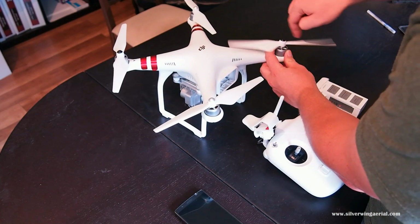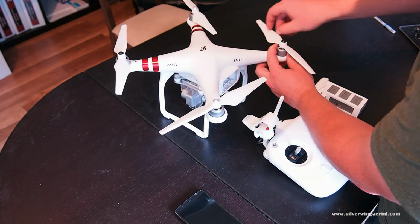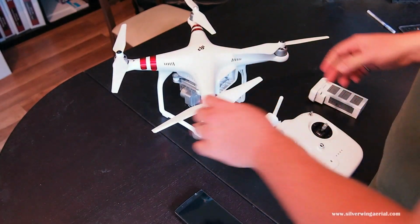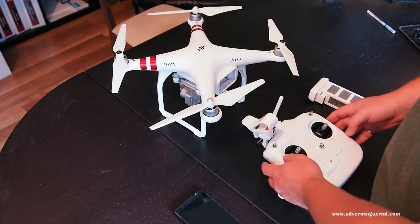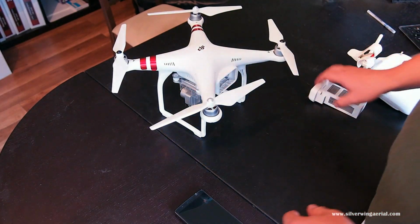Now I'm assuming that you've already done the firmware upgrade, which is in one of my other videos. I'll link to that at the bottom. So you want to make sure that you do that before you put the propellers on, because if you don't, then you could have a mishap where the propellers will start up before you're ready.